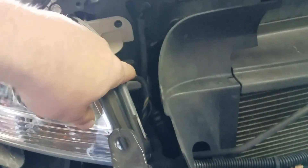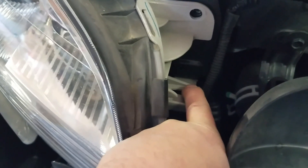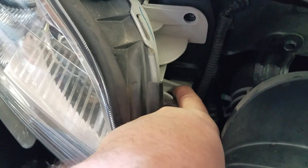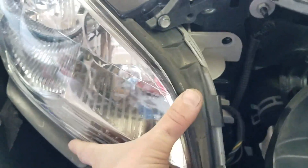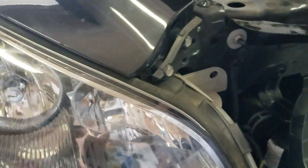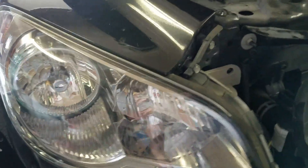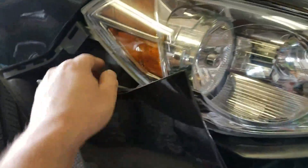Be cautious — there's a 90-degree clip here, flimsy plastic, that locks up underneath. When you go to remove it, be real careful. Jiggle it and get the left side out first — you can see how it drops down a little bit. If you pull this side down too hard, you will break off this little piece in the back.